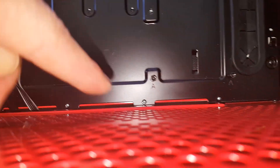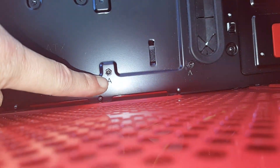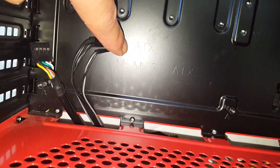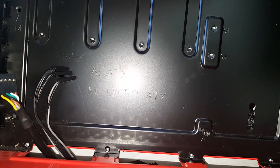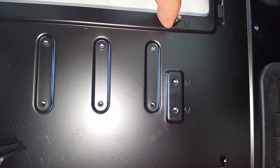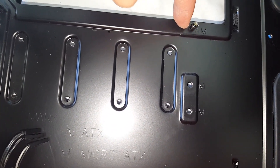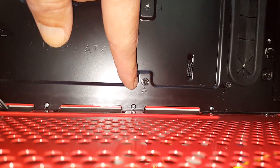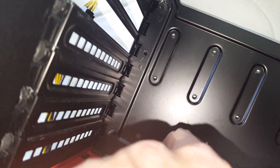AM, AM, and then down here you want the A, because this is a full-size ATX motherboard — it says A for ATX and M for micro-ATX. So even though these are AM, you still want to have them in there if you're putting in a full ATX motherboard, and you still want to put the AM ones in and also the just-A ones.